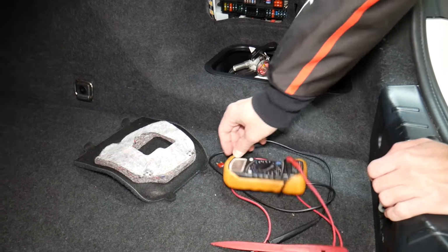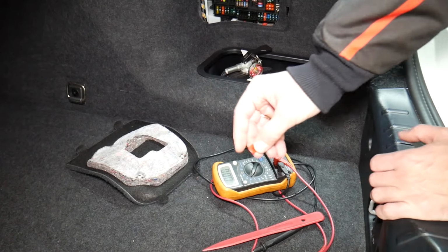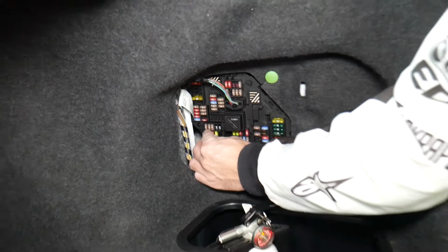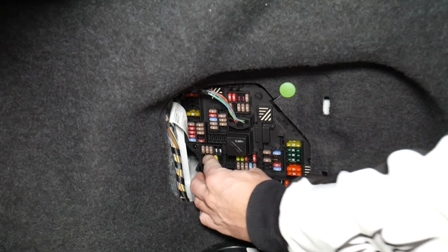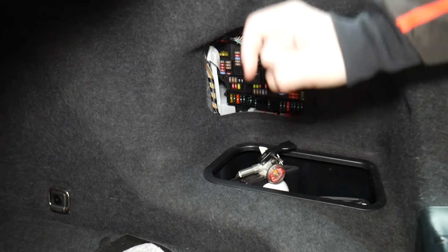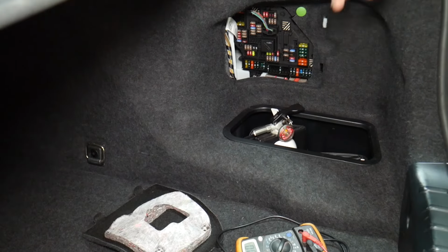So always test your fuses, even if you think it's good, always test it. It even happened to us, guys, and we work on cars all the time. Another thing, always test your relays. They're a little bit harder to test, but if you want to see how to test fuses and relays, we will put a link in the description of the video below.